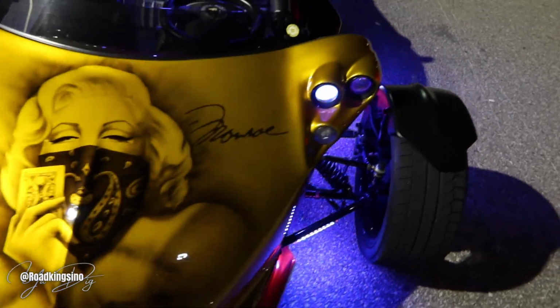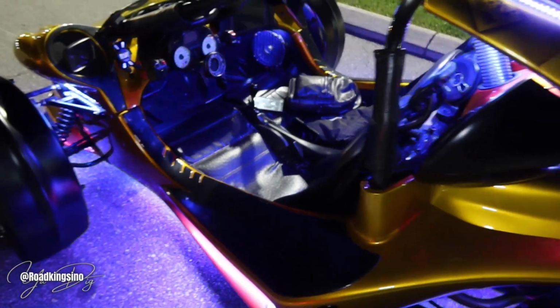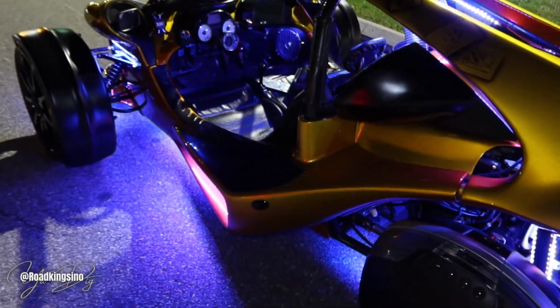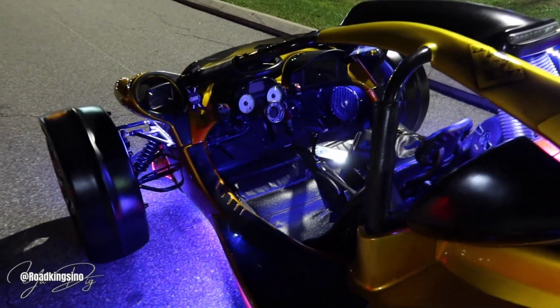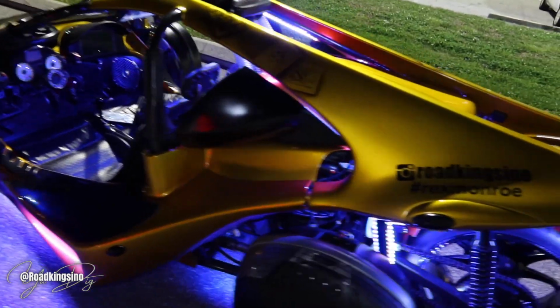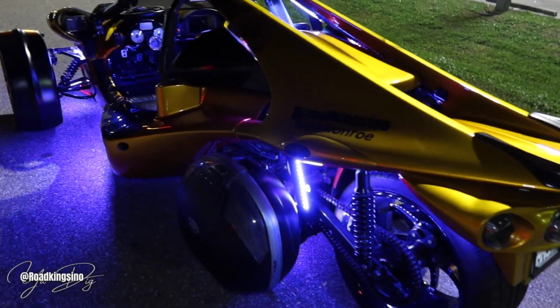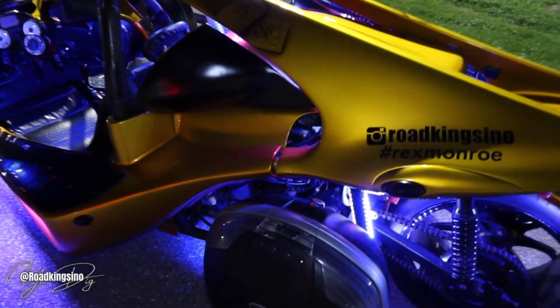My stereo system runs about 11 to 1200 watts RMS, okay? We're not talking peak, we're talking actual watts here. I don't have a very big system or anything like that, but it's enough to where it will drain a regular battery. I didn't have any issues with the yellow top, but I checked the volts on the yellow top when I pulled it out, and it was pretty much one full volt lower than this battery at resting volts.